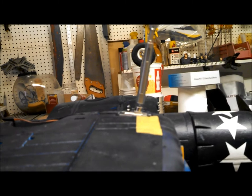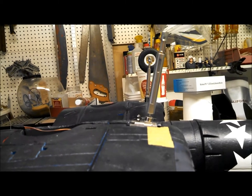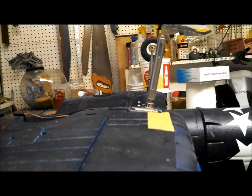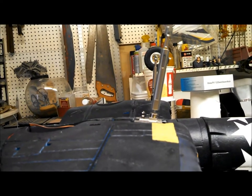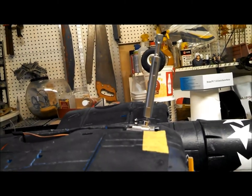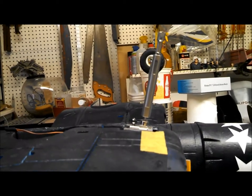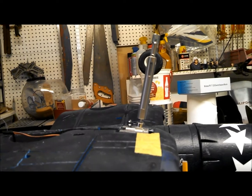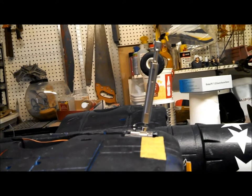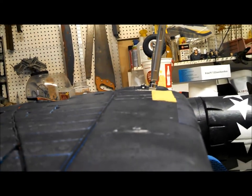You can clearly see the greater forward rake of the RC Lander units, which is a big plus with these warbirds. The strut diameter is only 3 millimeters, so my thinking is that if it's going to have to be extended, I would probably drill everything out to 4 or 5 millimeters and use a 4-millimeter motor shaft, which would be nice and hard and will not bend.